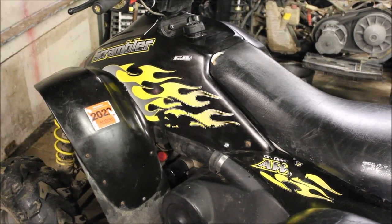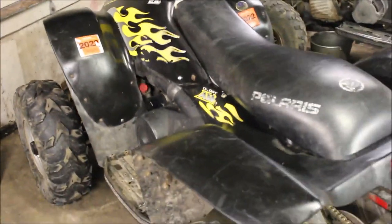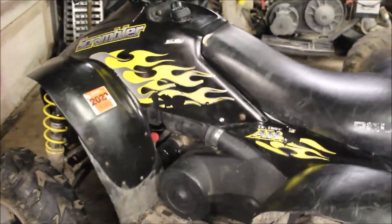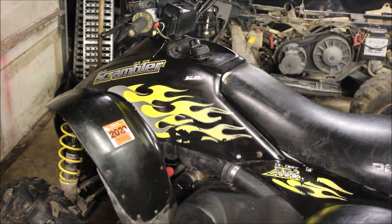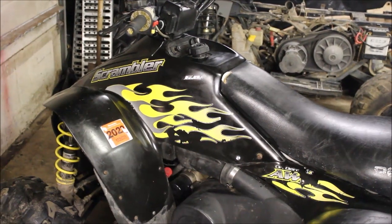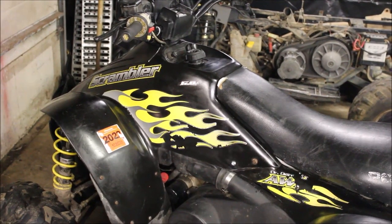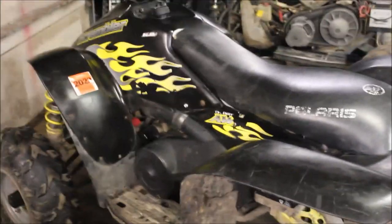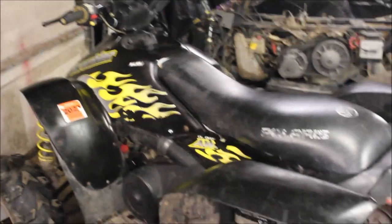So like I said, if you have an issue where you're repairing your ATV, put the plastics back on, and all of a sudden she doesn't want to run — give that a shot. Adjust your cables, just kind of go over everything. You may have routed the cables and wires differently. I've seen it time and time again where somebody did some repairs and even a wire harness wrapped around the wrong way and didn't make contact. So keep that all in mind while you're working on your ATV. Hope you like this quick tip of the day — hit the like button and subscribe. I've got plenty of Polaris repairs.